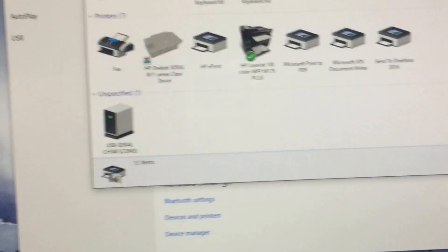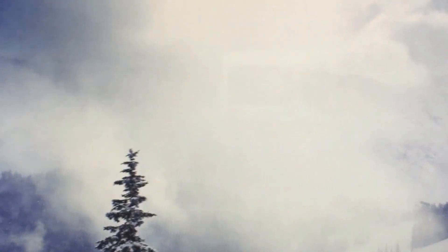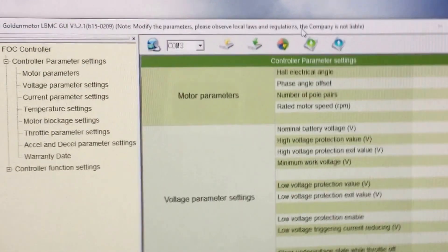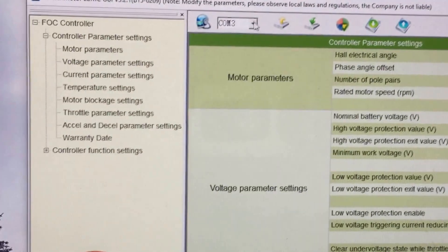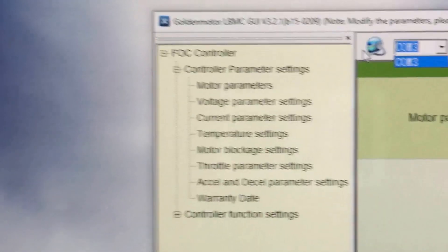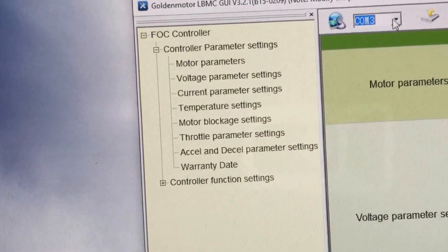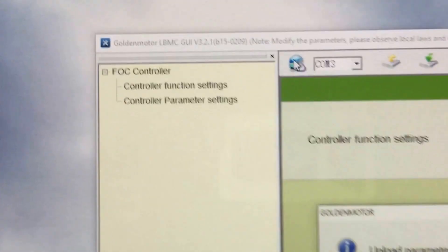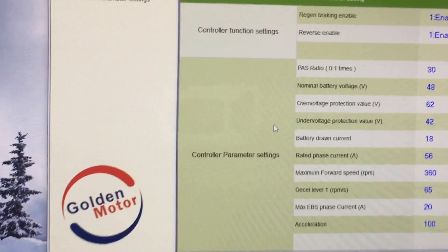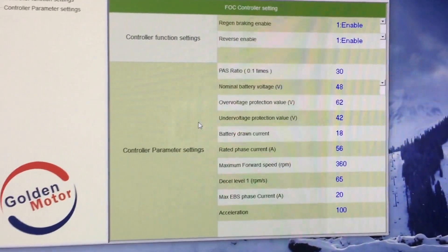To review one more time: I'm on COM3, so in the program all you do is load it up, select the proper COM port — you can confirm which one by checking the devices screen for the CH340 entry — then turn your battery on, select COM3 or whatever yours is, and click connect. I hope that's clear enough; it's getting very easy to use now. Gary Salo from Golden Motor Canada — enjoy the ride, and thanks for watching.